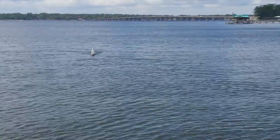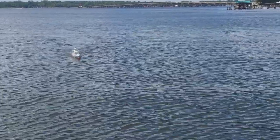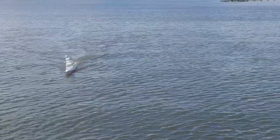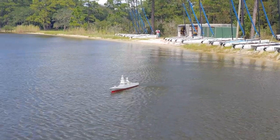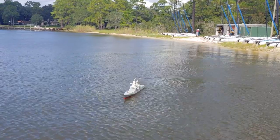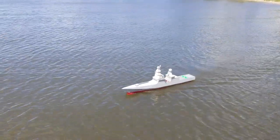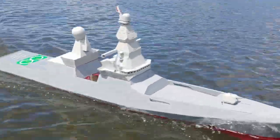With the extra speed of the hull, you can see that the rudders give a lot of kick, and that meant the boat was relatively unstable compared to before. This could be resolved by adding more exponential to the rudders, meaning the rudder would be less sensitive around the middle and more sensitive at the extremes, keeping its travel but allowing finer adjustment at high speed.